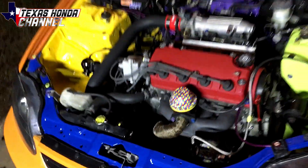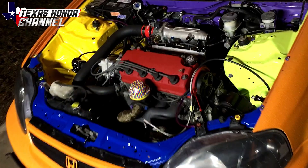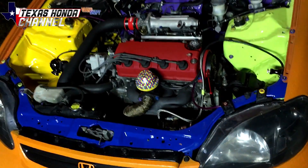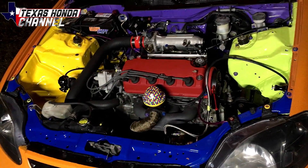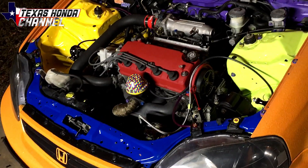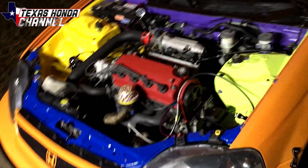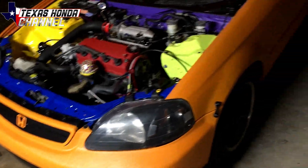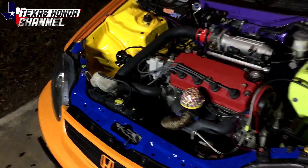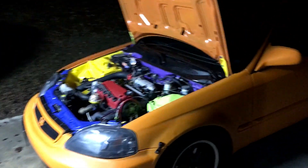It's doing really good, I'm really happy with it. I just figured I'd give you this video, show you us going through the gears, and tell you what's going to happen in the future: six-puck stage three, lightweight flywheel, and a short gear transmission, because this one is extremely long geared. The airfuels were in a beautiful range — we never went above 12.5, which is good. I like it right where it's at, so we're just going to leave it there for now. We'll get it to the track eventually. But I've got more videos coming out, so definitely stay tuned. I'll see you guys in the next live stream. Until then, stay safe, God bless, and have an awesome New Year's everyone.